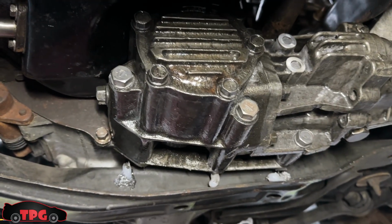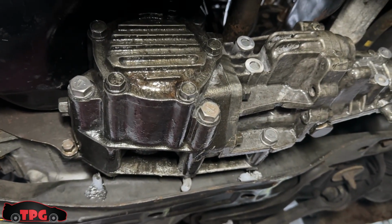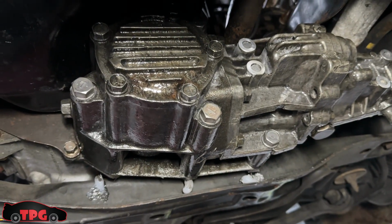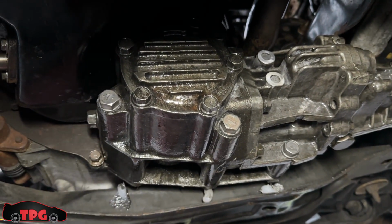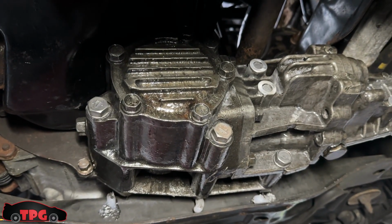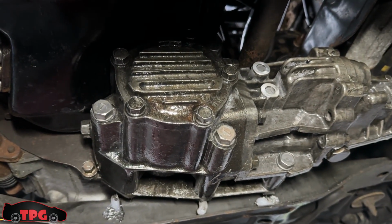But this transfer case, secondhand, has been off, what, 3 times with me so far. So I've lubed everything, cleaned everything, chased threads, chased holes. If these front two need to get done in the future, no big deal. It's easily accessible. I can get the drill bit in there and all that. But now we have good, strong threads. Our transfer case is back in.